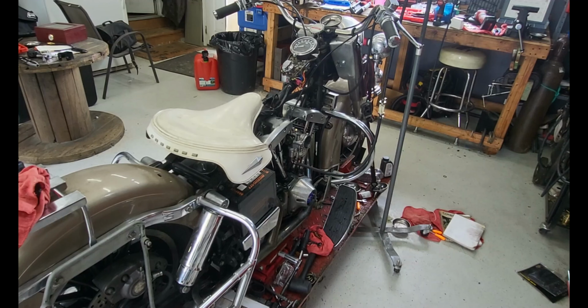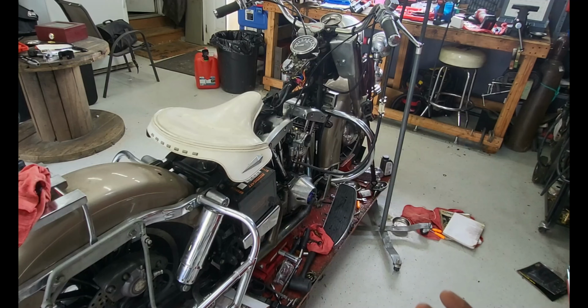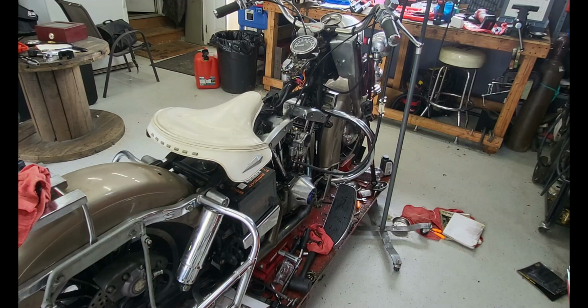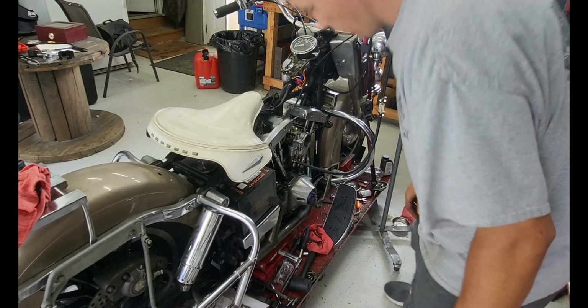Rear cylinder was dead as can be. Okay, we went over the rings, we know all that's right. So that means that one of the push rods was misadjusted. Okay, so I rolled through the push rods again. Lo and behold, now we got 85 pounds on each cylinder, which is great for a cold motor. So let's give it a start now. After I put this back on.